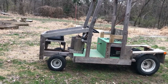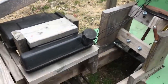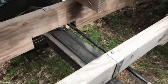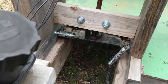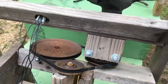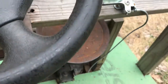For the front steering, this came off of a riding mower — it was a Craftsman GT 3000. I mounted the steering wheel in the middle and then did this pulley system here to transfer it from the steering wheel, which is offset, to the pulleys. I put my key starter in from it, and that's my throttle switch.